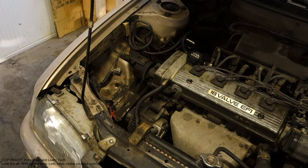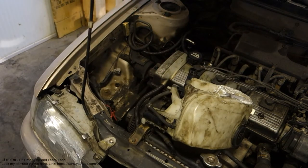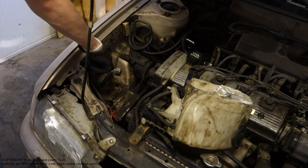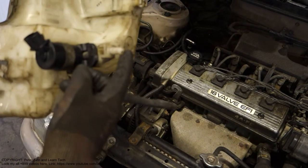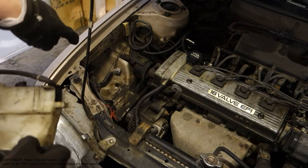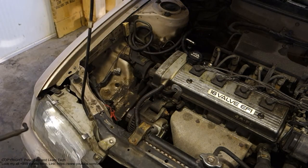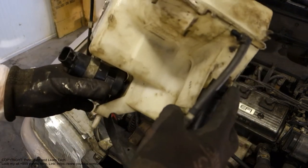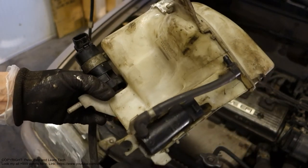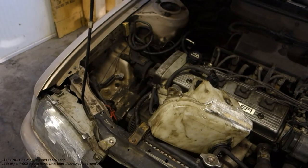Okay, and then I am planning to install this washer fluid tank back, and it happens so that I notice that in here we have one hole. It is good to notice, and in here we have a similar hole, and this hole goes first in this down area. Then of course there is this pump's electric cable that I need to connect in here, that electric pump, and there is also a second pump that I need to connect, but those two things are the most critical. Let's look at how I managed to install that.